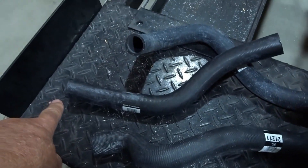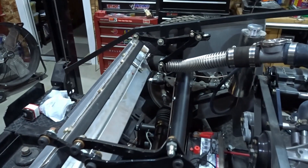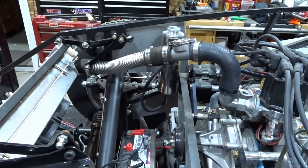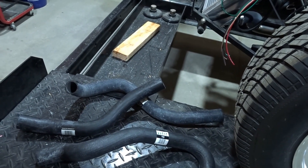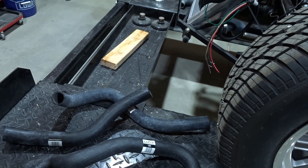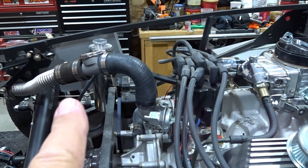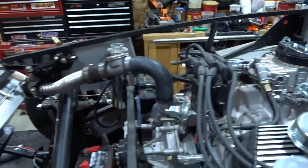What I'm looking for is an offset that changes the height from one side to the other, because our radiator hose starts low at the radiator and ends up high at the filler cap. I also wanted, if possible, something I could use in its entirety to eliminate having to buy two hoses — ideally one hose with a 90-degree bend for the thermostat housing and that offset change down to the radiator.